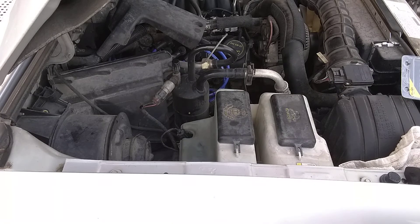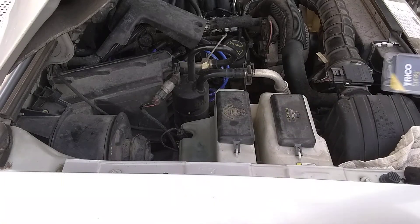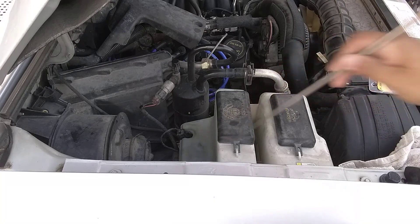Actually, the new pump does make some kind of sound, but it's not as loud as the old unit. It will get louder as it begins to fail, and once it fails that's it — you'll have to replace it. The sound it makes before going out — I don't have the original to show you, but you can Google the number 11-521 washer pump to see what it looks like.